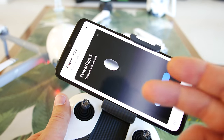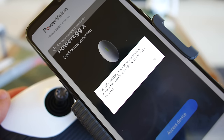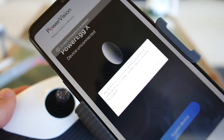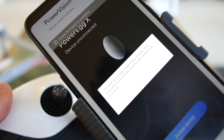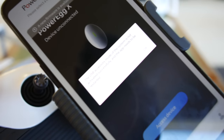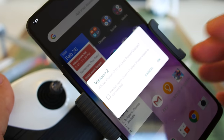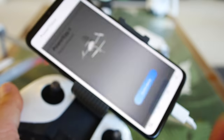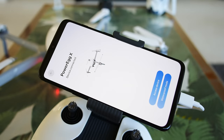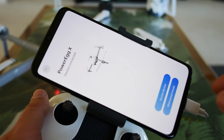When I plugged in the USB cable again, it said the USB accessory mode is not activated successfully and the app needs to be restarted. Let's try that again — just leave the USB plug in. There we go — so it's all connected. If you have connection issues like that once in a while, just restart the app and plug in again. Make sure you confirm all the access to your phone and you should be okay.